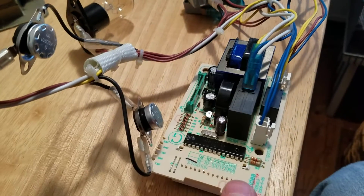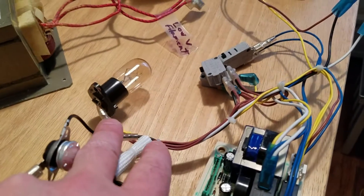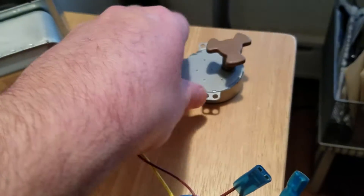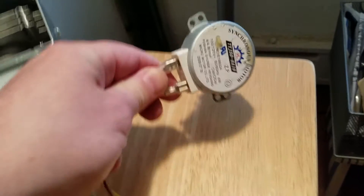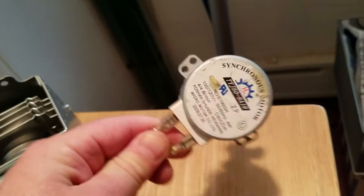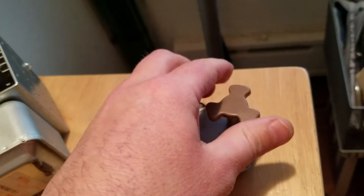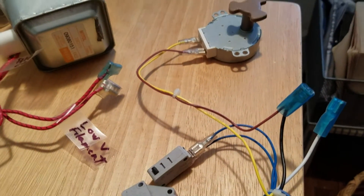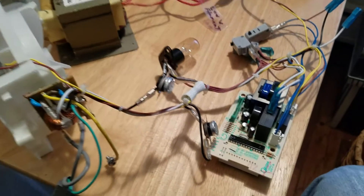The rest of this is just a bunch of 115 volt components that includes the logic, the microwave oven bulb, safety micro switches, and this turntable permanent magnet motor that you can crank and turn into a 115 volt generator — which is something I plan on doing something with.